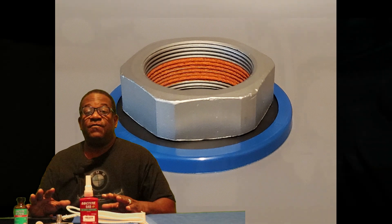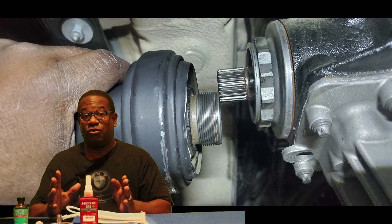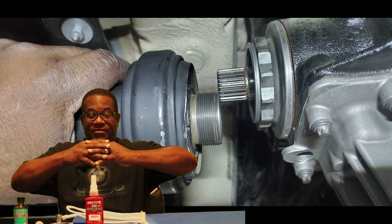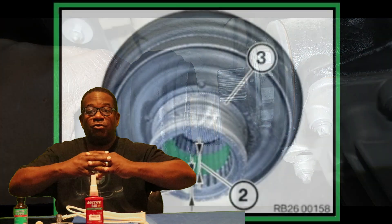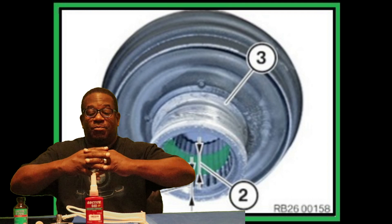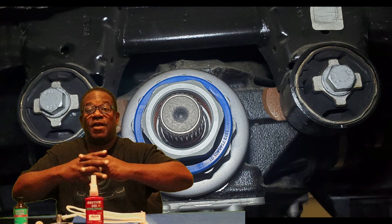What it is, is the way our vehicles are designed: the drive shaft splines between the drive shaft and the differential have an adhesive that holds the splines in place as you drive and the drive shaft rotates. Under normal driving circumstances, this adhesive could crack loose, allowing the splines to move. It could also break loose from lowering or raising the differential too much.